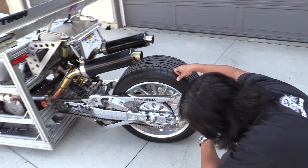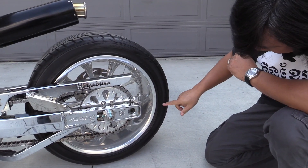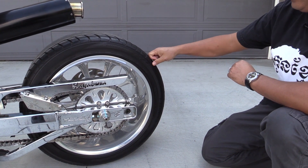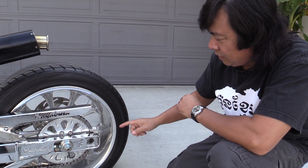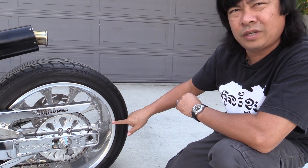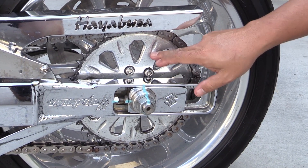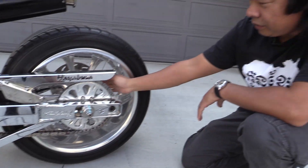The wheel is an 18-inch wheel. It fits this tire — 285/35/18 tires. The guy who put this tire on this wheel had a hard time because the tire is a car tire but the wheel is a motorcycle wheel. Then I had to buy the rear sprocket and modify it to fit the bolt pattern of the wheel.